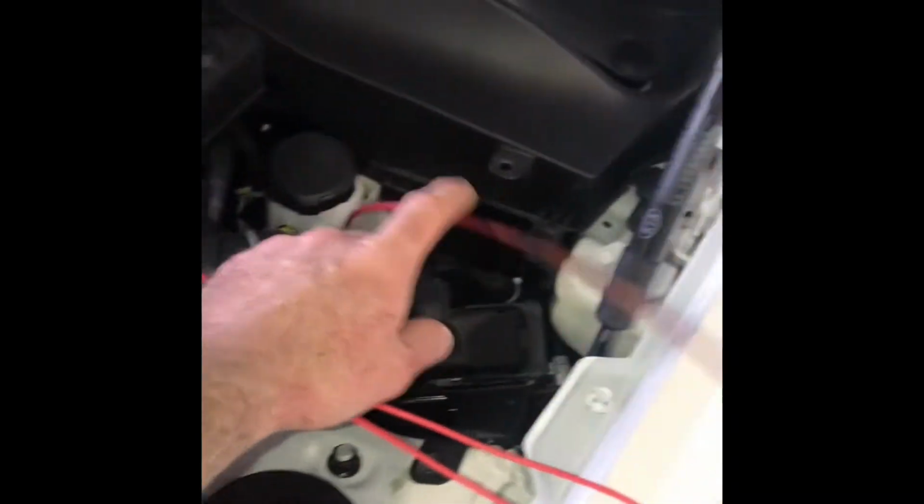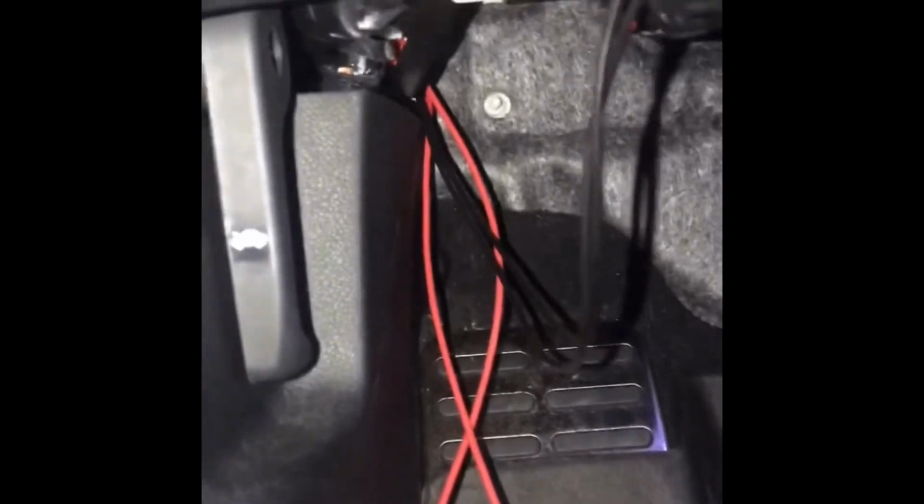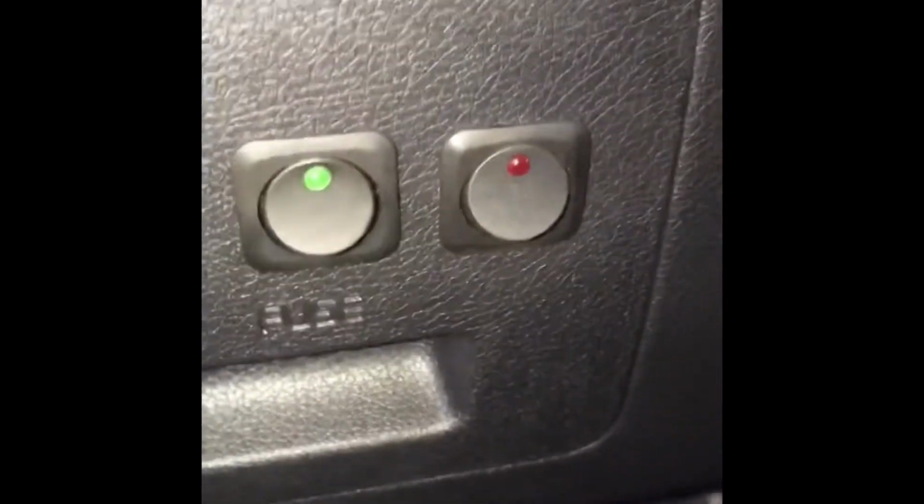Go right through there. There it is. There you go. There's my JB4 wires, and I'll go right next to them, feeding my wires here. Here's my little fish tape run through. First, that's where you need it. It's all tight and snug in the engine bay, then you know you'll have plenty of wire over here, and you can snip it. And there's my switch.